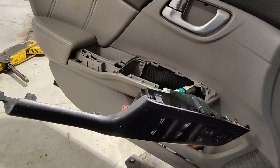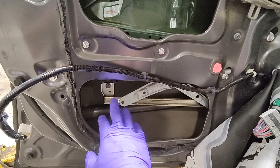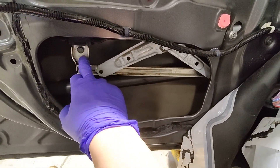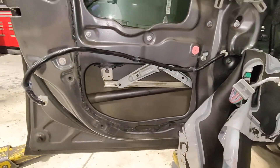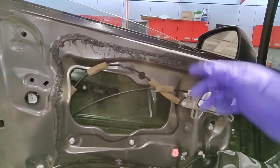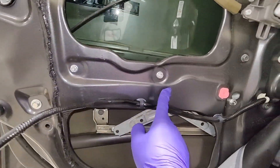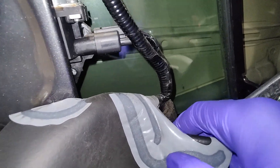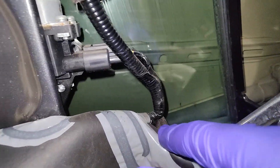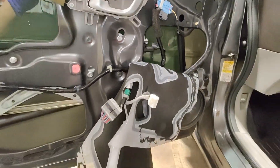That's pretty much it. Once you've got the door panel off, you gotta drop the glass down to this height so you can get at these bolts. There's also a hole right here for the other bolt for your glass. Once you take that off, I can tape up the glass to hold it up. Then you unbolt these two bolts here and another one over here, and disconnect the connector for the window motor.